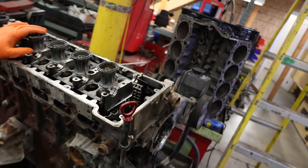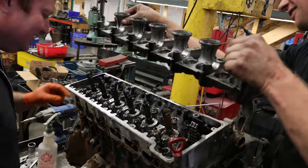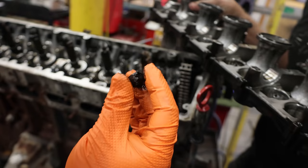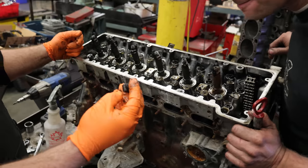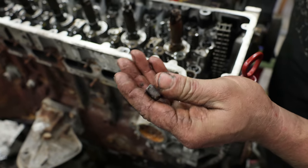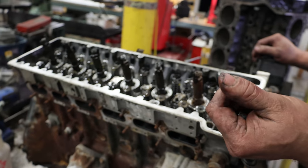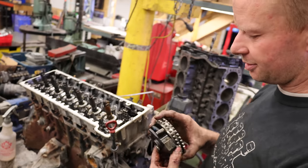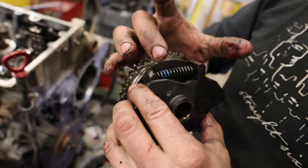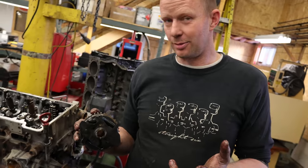Hey, these are safety dots on your head. That's just my hair pick. What's that? A little square — like off an old-style clamp. I don't see anything else floating around. Probably a friend playing a joke on them. You guys gotta help me out here. This is the drive gear for the pump, and it looks like it's got a variable timing on it, so it would retard the timing as it loads up and pushes up against the spring. That's my only theory — but if I'm wrong, let me know.